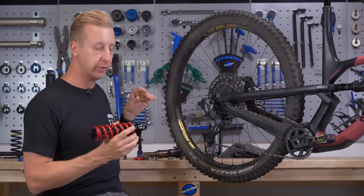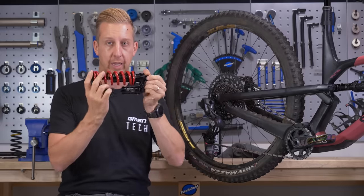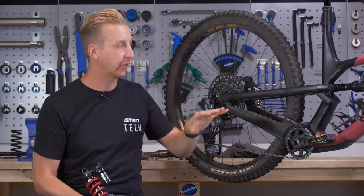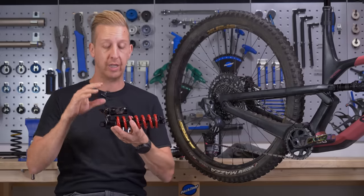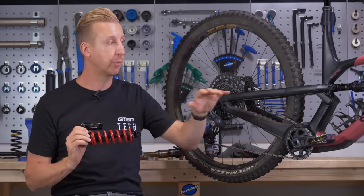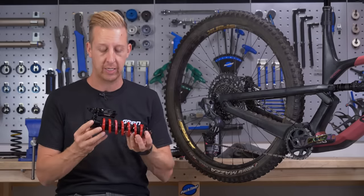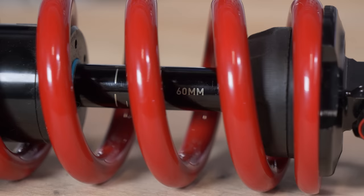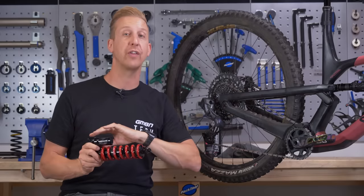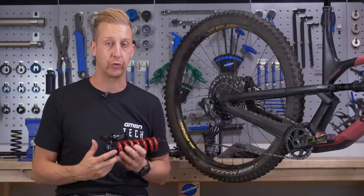When it comes to the hardware, you need to cater for the orientation of the piggyback and on which end of the bike it goes — it won't always be the same and depends on the room in your front triangle. Some bikes simply won't be compatible with having a piggyback. Definitely check all these things before you order. You also need to make sure the shock is the correct eye-to-eye fitting — that's the length of the shock — and has the correct stroke, meaning the amount of travel the shock offers, to correlate with your bike's design.